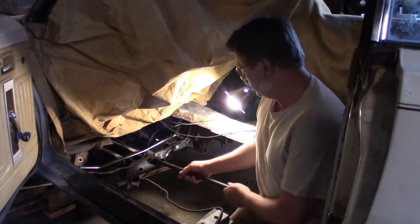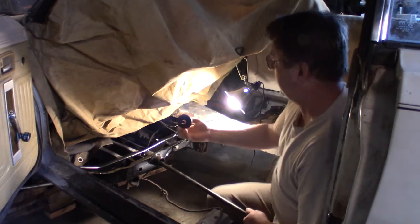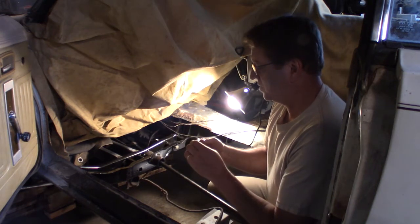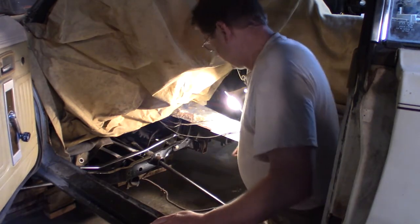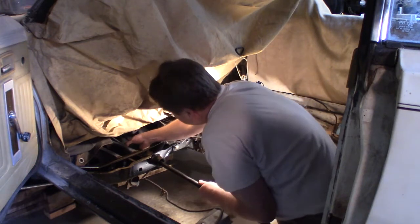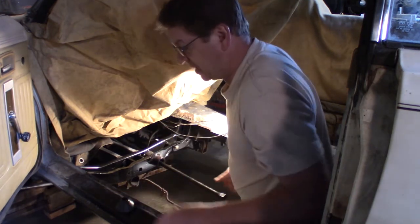And then I'll have to go line it up with the front suspension, the lower control arm. But before I do that, I got to get this dust boot over top here and squeezed on there. I've heard some people complain that this is too tight to get over it. And it does. This is pretty big compared to what I've got to push over. So we'll find out how that's going to work. I got to see if I can get this boot on. This is not going to be easy. You know, I'm thinking I'm going to take my heat gun and heat that up a little.